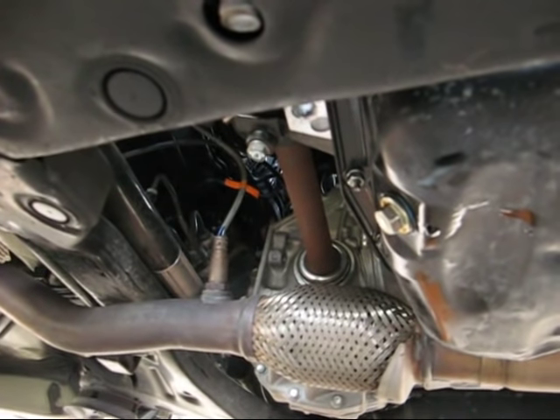Here's where you add the oil. I'm using a little funnel to make it easier for myself. I happen to be using 5W-30 and I'm using regular, not synthetic — I'll probably get a thousand comments on that. What I do is I change my oil every 5,000 miles. The recommended interval for Toyota is 10,000 miles using synthetic, but I just like this better. There are a lot of videos on YouTube that'll explain the difference between the two and why people use one over the other.